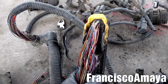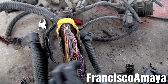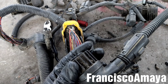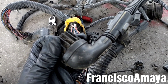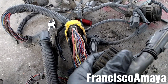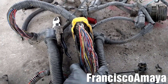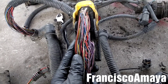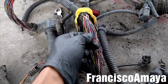So for example, if you go to a shop having issues with sensors or whatever and you want to replace the engine harness, don't let them replace the injector harness just because it's leaking oil. Yes, it's true it is leaking oil, but that is not the cause of the engine harness going bad. Eventually your engine harness will go bad even if you put a new one, because the vibration of the engine is going to start wearing the protective material apart.